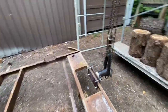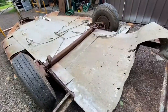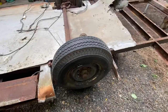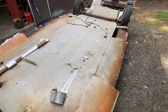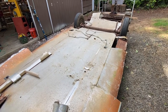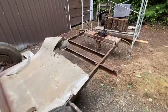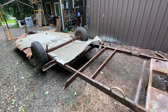That was awesome — everything worked out just as planned. The fixtures I welded up to pivot this worked great with the chain hoist. Now I'll be able to spin this quite a few times. With it upside down, I'll be able to strip off all the aluminum, cut the rivets, take off everything on the underside, pop the wheels off, sandblast it, do some welding, flip it over, sandblast the other side, attach some plywood flooring, flip it back over, insulate the bottom, and stretch some new aluminum over the whole bottom. Then flip it back over again, drive it back up to the other shop, and put the shell right back down on it. Next time I see you, we'll be sandblasting and doing some welding and cleaning this all up.